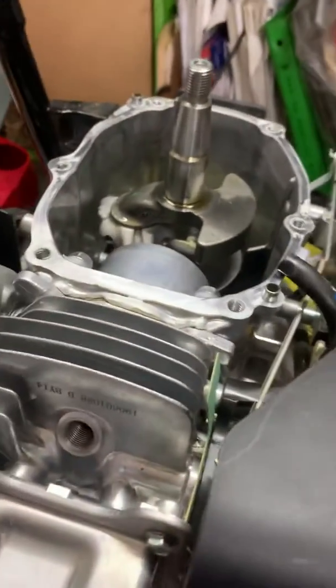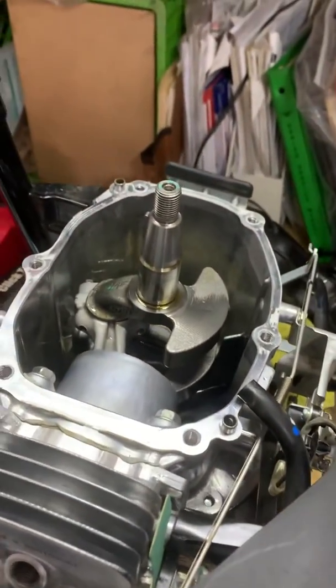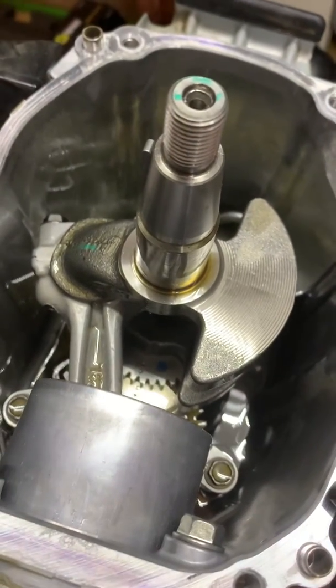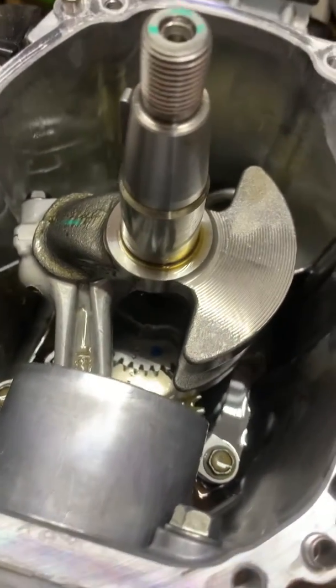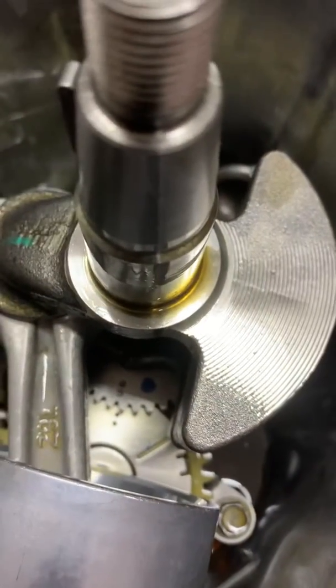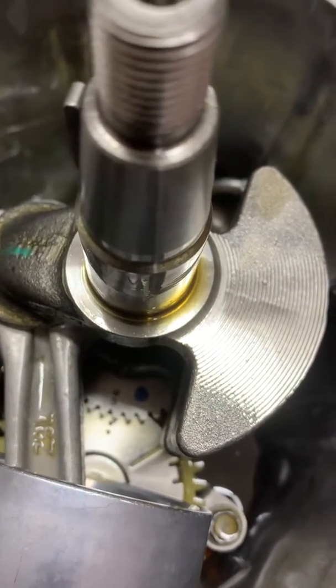This is the underside of the top lid, or the crankcase cover — fairly simple. In regards to comparing this to the old HRX motors, you have the timing belt moving through the crank and onto the timing gear, whereas this has the timing gears down there and does not use a belt.